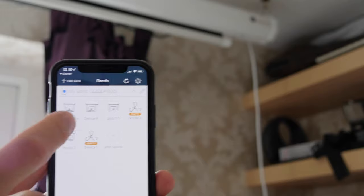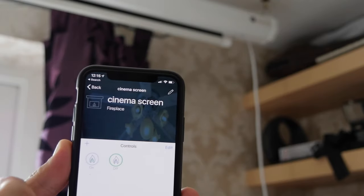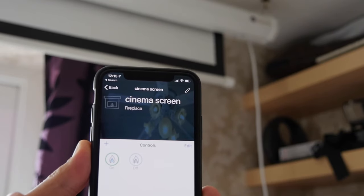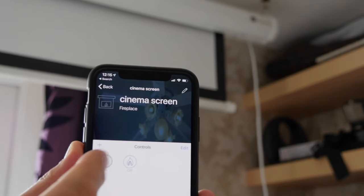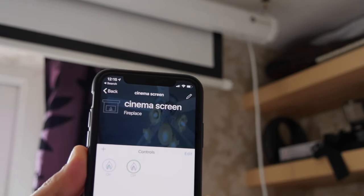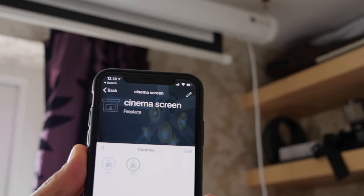So how was I able to control my cinema screen using this? Very simply, I just told it that it was actually a ceiling fan and added it like that. I only used the on and off codes since that's all it really needs, and then exported that to Google Home. So my Google setup right now thinks that that's a ceiling fan. But of course, if you tried to send a percentage speed value or something, it just wouldn't support it. So there is a kind of workaround you can use, but it's obviously not ideal.